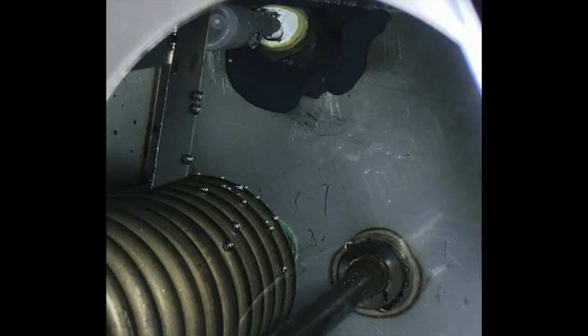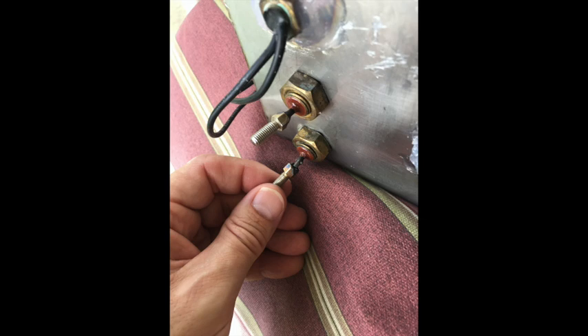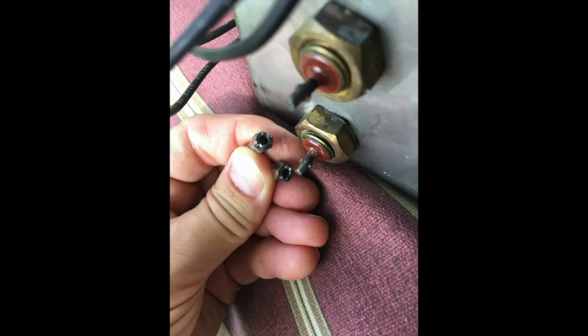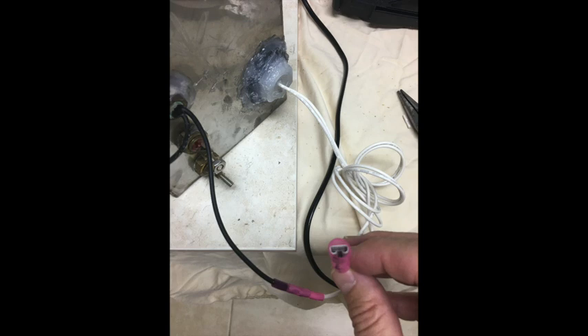I did a water test with the water at maximum level — no leak at all. Then I made the connection between the float switch and the thermal switch. I noticed that the high-voltage connectors were actually soldered onto the heating coils, not just slipped on, so I had to re-solder them. I then did my conductivity test between the float switch and the thermal switch and noticed intermittent continuity again. I decided to cut the extra length of wire on the float switch — and it worked.